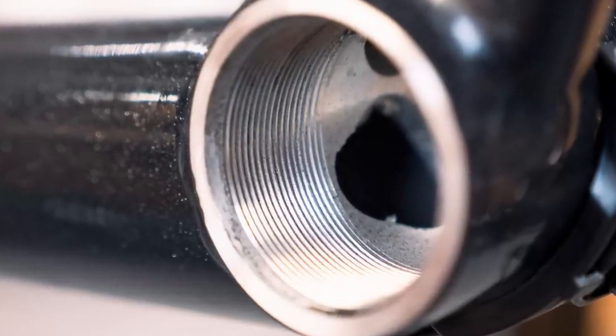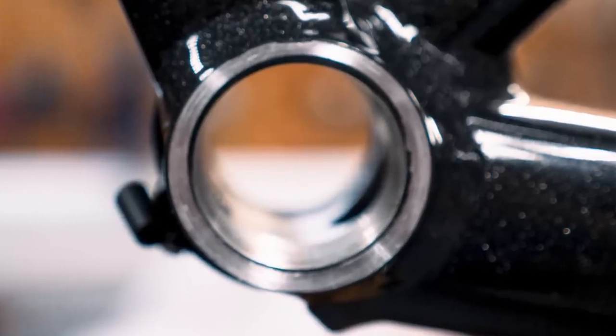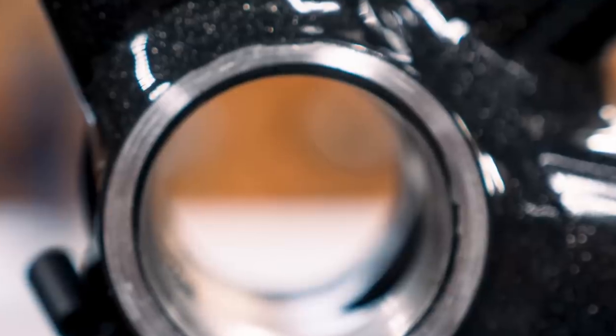This is quite tricky to do because there's quite a lot of other stuff going on in the area and it's hard to get the tool into place — you have to be really careful. This close-up is of the bottom bracket once it had been chased and faced. The threads were fair — the chasing tool went through pretty easily — but the facing tool needed quite a lot of work to get rid of an awful lot of paint and actually took off quite a lot of metal as well. So that face definitely needed doing, and that's what it should look like when done — just beautifully smooth metal, shouldn't be anything else in there. The other side is slightly out of focus — my macro photography skills aren't quite what they should be — but the face, the important bit, is really really flat so that when we have that bearing cup we get that lovely flat interface. You can still see some black paint in there because of the slope that goes down into the threads, which is really hard to remove, but no part of the bottom bracket should be touching that — it's all about that flat face.